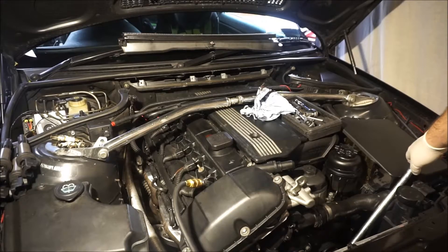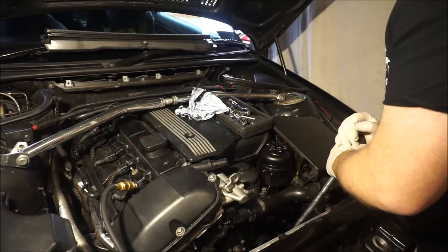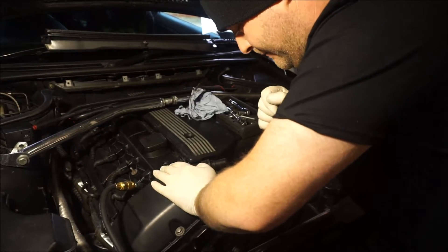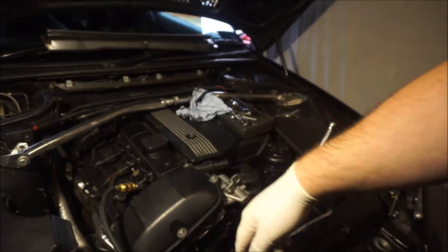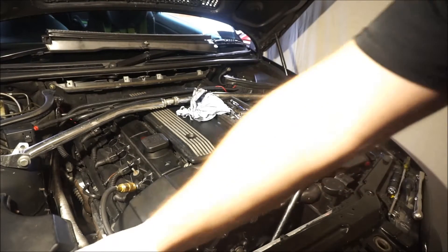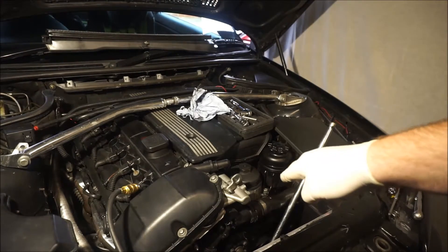Watch guys - when I apply the pressure, you can see this bar move to the right. That's because we have so much pressure in the cylinder that the piston actually pushes down, compressing and pushing everything down with the bar. Now we've got a leak because we are off the top dead center. We've got a big leak now because cylinder number one is no longer at top dead center - and this is the problem. This is where the guy did it wrong. You need to make sure you have top dead center maintained at all times.